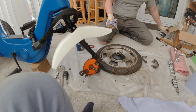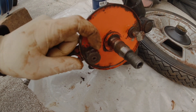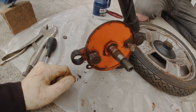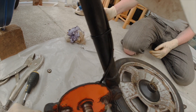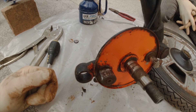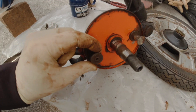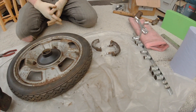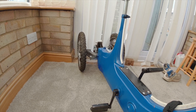The last half hour we've had a bit of an issue with the brakes. This little spindle was literally welded — stuck, not going anywhere. So we used some of Vinny's magic juice: a cocktail of penetrating fluid with some automatic transmission fluid. Now I've been working it forwards and backwards, round and round, and now it's just about right. We're going to put the shoes back on and get that all popped back on with the wheel, then we're going to start on the money shot — getting that motor on!